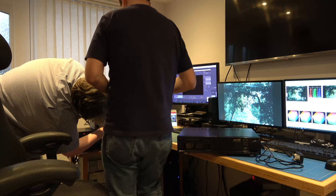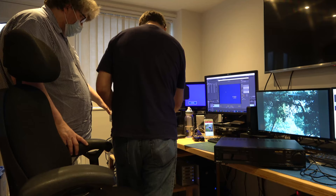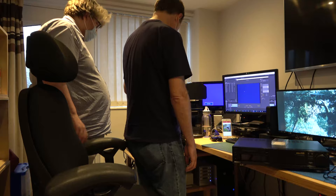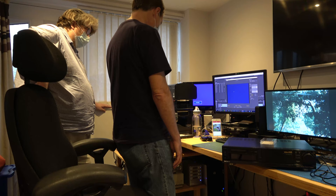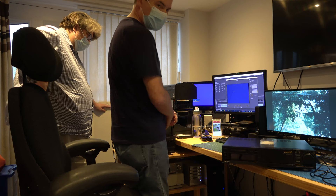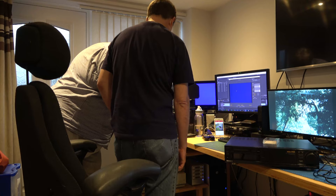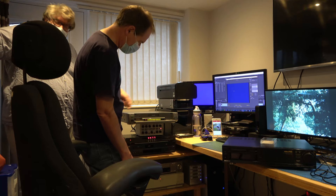We have one of the machines we're going to test here. We'll definitely need to rewind. Should we do a high-speed rewind? The great thing about the EVC 2000, like the EVS 9000, is it's got a turbo rewind function — it rewinds unlaced, which is pretty much unique on 8mm Hi8. Most 8mm Hi8 machines are laced during rewind. So it's a turbo rewind, but you don't get a tape counter because it doesn't have any heads next to the tape. It certainly sounds like it's rewinding beautifully.